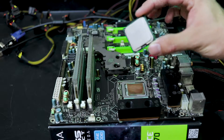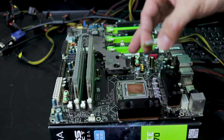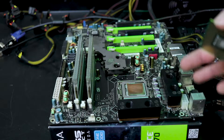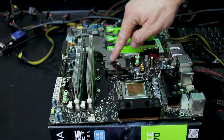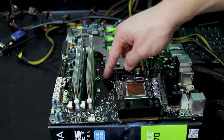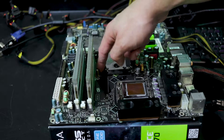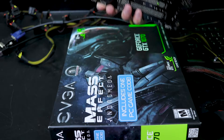This is actually a Core 2 Duo I had laying around — I was ready to test the system and make sure the CPU wasn't the issue. If you know a CPU is good and you put it in the motherboard and it still doesn't work, then in this unique case I would remove the water block and make sure there was no metal-to-PCB contact. There are little nylon gaskets that go between the block and the PCB to prevent shorting — same thing on the rear. After taking it apart and reinstalling everything, I would then retest.